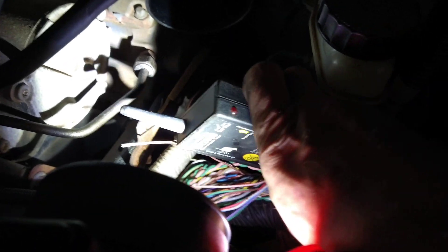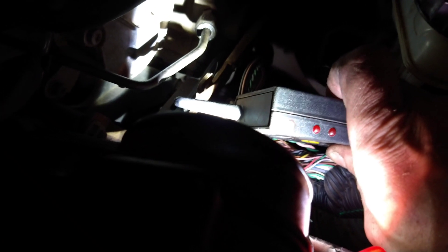A few people have asked about this tool — when you find the same wire it's bleeping away, but sometimes you can get false readings. If you're on the wrong wire, or even if you're against the engine block, it can still say open circuit. So you've got to keep looking for the fastest beep. For finding a broken wire though, it's pretty good. Now I can join that wire back together, check for power on the other side, and the car should start.